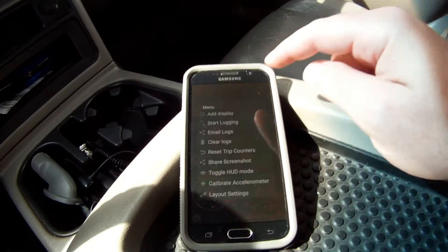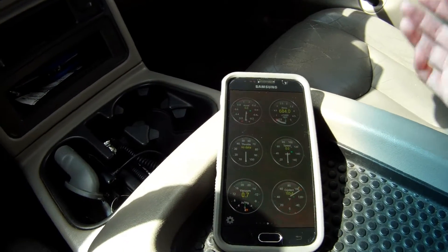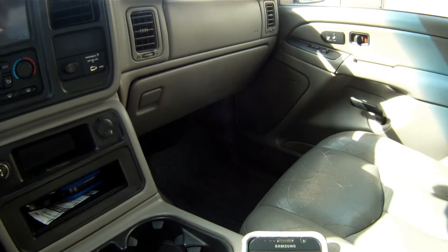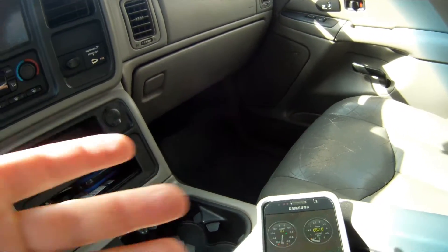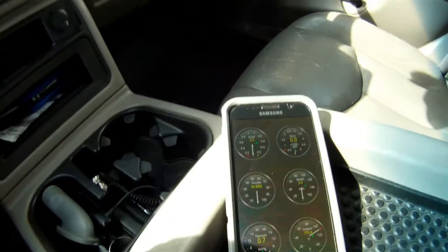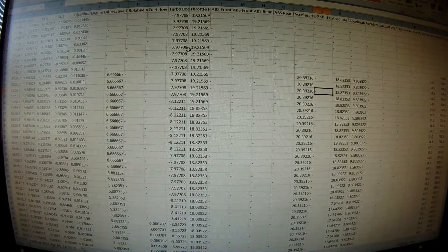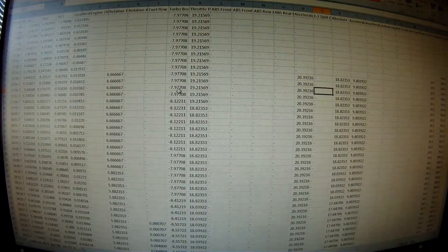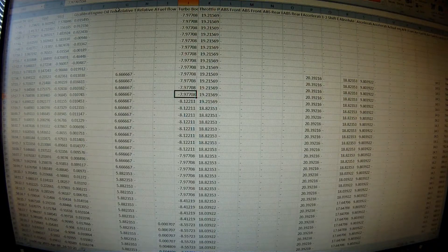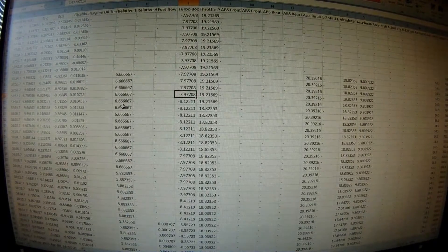You can email the logs from within the app, or you can plug your cell phone into your computer via a USB cable and find the files in the track logs folder on the app's SD card. My phone is a Galaxy S6 which doesn't have an SD card, but the S7 does. At this point I've downloaded the CSV file and my GoPro video to my computer. In the raw CSV file you can see all the different data you can select and record — I have all the GM PIDs configured and that's what I use to record.